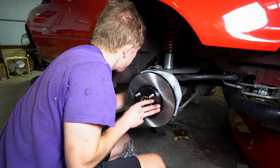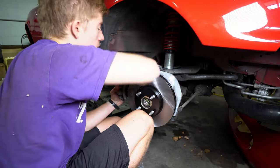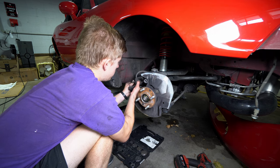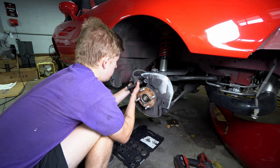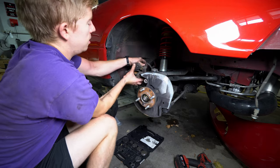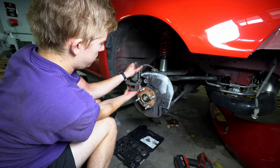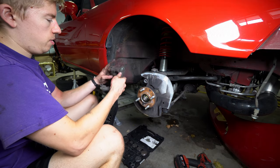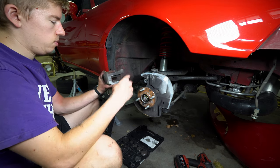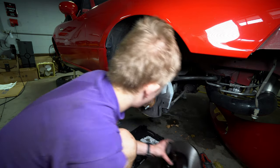Get our caliper back on — that'll hold the rotor in place. Then I can put the rotor on, and then none of this junk will be in the way to get the piston compressed. Taking off that 14 and that 17 slider, then we'll put the 14 mounting brackets. This will go like this because the 17 was down towards the bottom. Set that aside, put our rotor on.